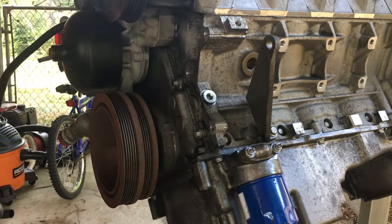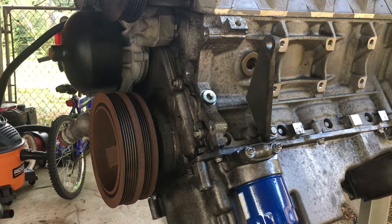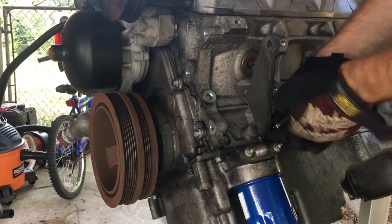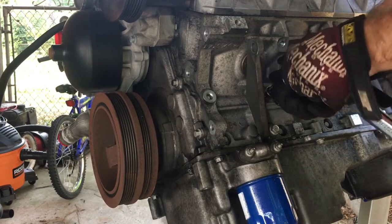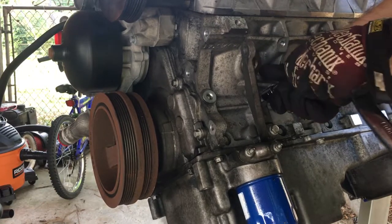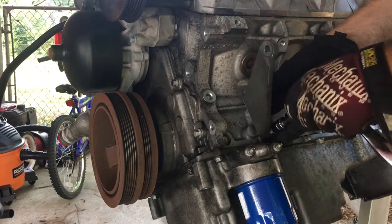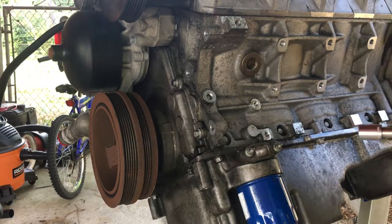Just taking off the alternator bracket — you have the one fixed wheel, you can see how it's been worn a little bit, but should be fine. That clearly could use some cleaning up. Switching to a 13. Also something you need to be careful with — because it's an aluminum block, things are not torqued down very tight. So you want to make sure you follow your torque specifications, because if you over-torque and strip the block, that's going to be a real pain. You'd end up having to drill and tap it, and that's just a whole load of mess. So just be careful when you're doing this stuff — you don't want to strip your aluminum block.